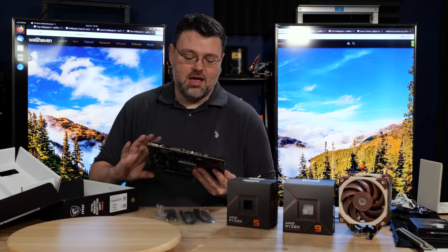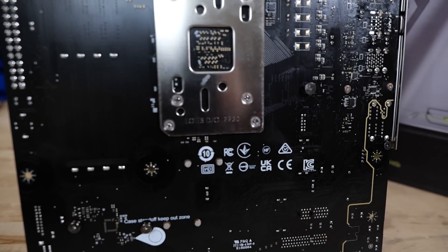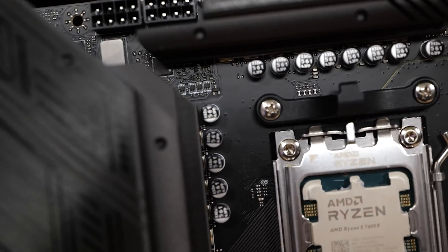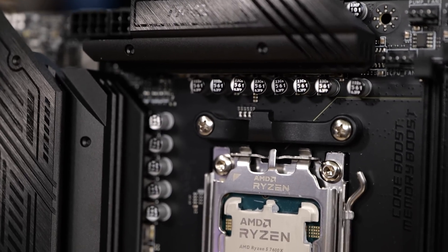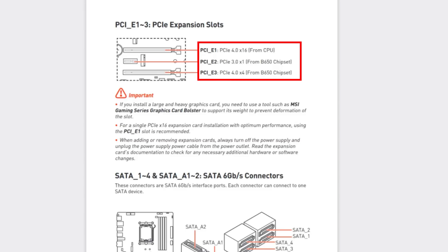That's what you give up with this motherboard. It still has four DDR5 DIMM slots with surface-mount DDR5, so you'll be able to run DDR5 at pretty reasonable speeds. There's also a good enough VRM to run the Ryzen 9 7950X. The PCIe layout is pretty intelligent — the M.2s are connected directly to the CPU, but limited to PCI Express 4.0. The bottom physical slot is physical x16 but x4 electrical, connected through the chipset, running at PCI Express 4.0 as well. The PCIe x1 slot is also through the chipset.